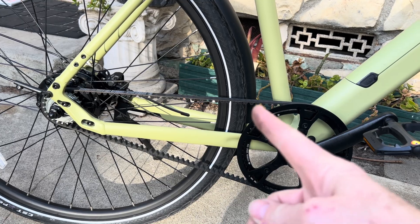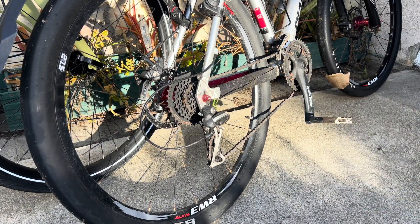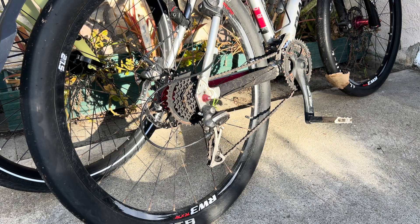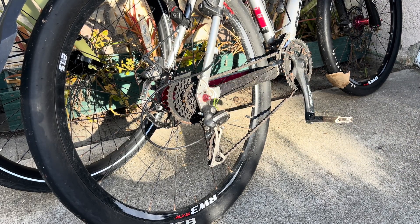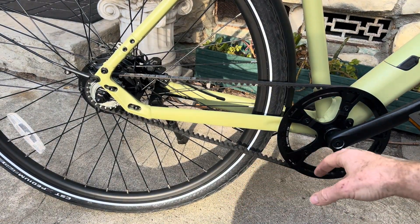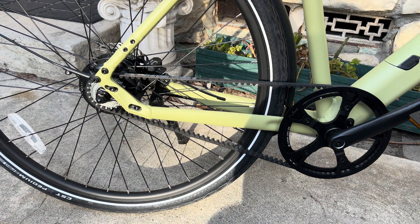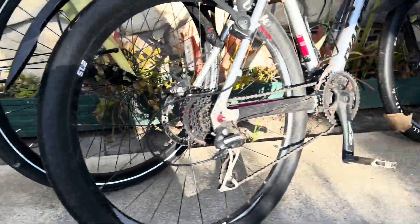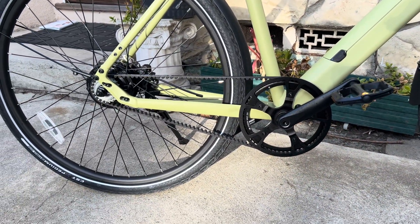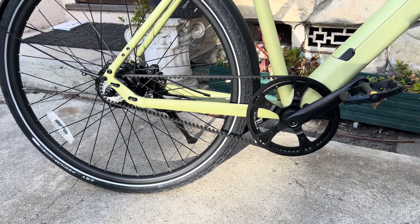It's definitely going to cost more money for the belt, but I've had to ride home with a broken chain, ride home with a broken derailleur, deal with the chain skipping repeatedly, and replace the rear cassette three times. So if you're a heavy user or just don't want the hassle of keeping your bike clean, this works really well — you barely need to clean it, dirt doesn't really stick, and some YouTubers who've gone around the world on bikes ride belt drive for its reliability. The only downside is parts availability if you're somewhere that's never heard of belt drive. If you're on a bike you've made the right decision — it's just a matter of your style, your budget, and if you want to give the belt a try, I highly recommend it.